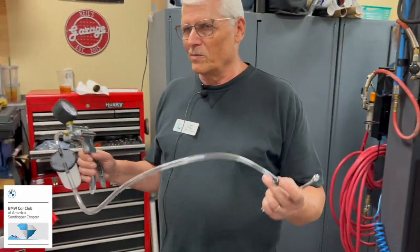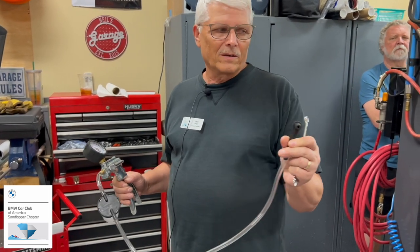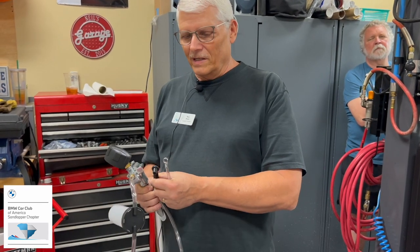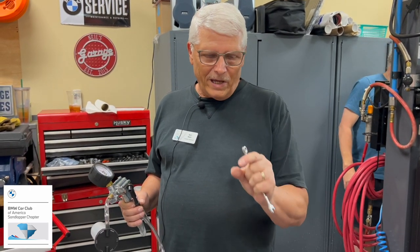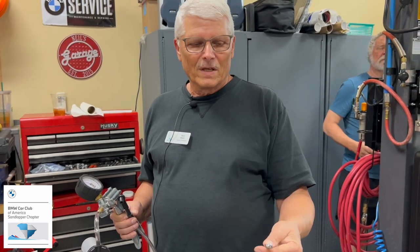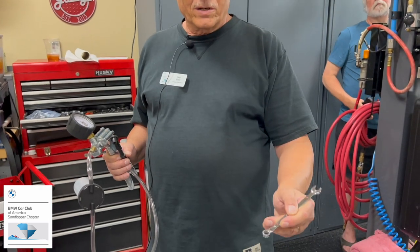This is like a little vacuum pump. So you take this piece and you put it on the bleed valve. Every caliper has a bleed valve, and we'll do it on this one next, but I'm just giving you a preamble. There's a little dust cap you have to take off the bleed valve so no dirt gets in there. Then this happens to be a 9mm wrench. So you open it a crack.